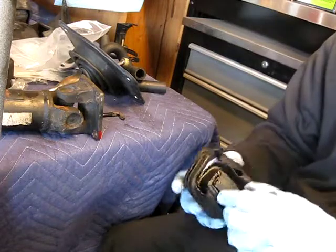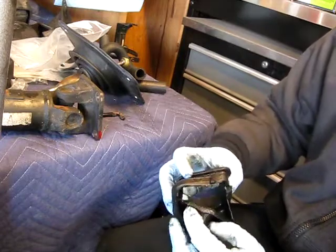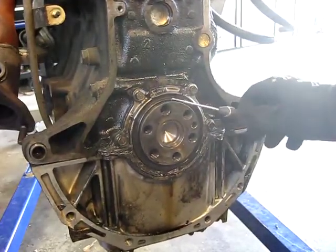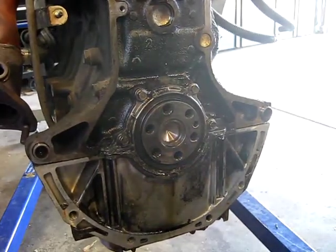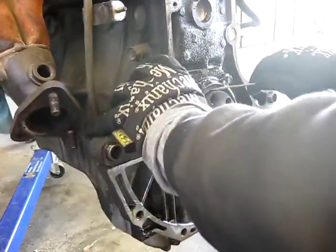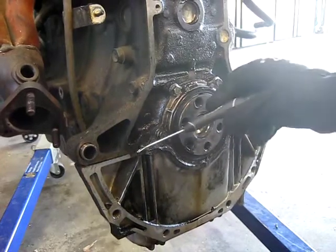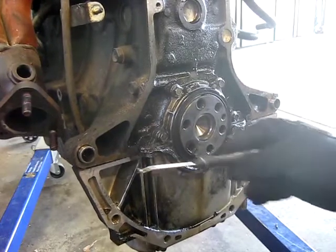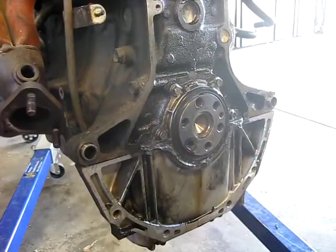This was the clutch fork lever boot. I was a little satisfied to see that this rear main seal has a gap, which means it's probably so dried out and old, simply shrunk, and is no longer an effective seal. I actually stuck a hook in and was able to just simply turn it and pull it out. That was a big issue. I'm a little worried that part of the oil pan area is also leaking.